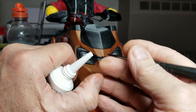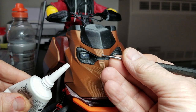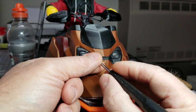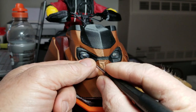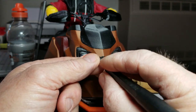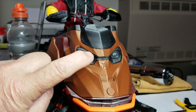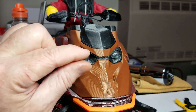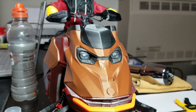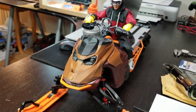Take a small screwdriver and here's how much silicone to use — just that much on the tip of the screwdriver. Go on the inside of the headlight buckets and keep taking little dabs, spreading a thin film of caulk. Start from the back and wipe it this way, move over and wipe it, get another small dab — get an even film of caulk around the inside of the buckets. When you slide the lens in place, it'll scrape that silicone caulk right up against the back edge and leave a nice bead. Take your time to do it like that and you'll have yourself a Ski Ride 2 that you'll just love to take pictures of.